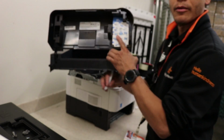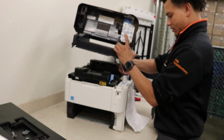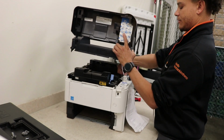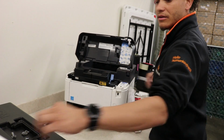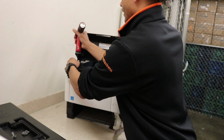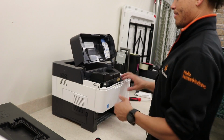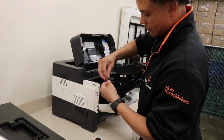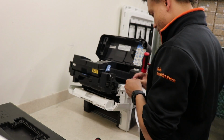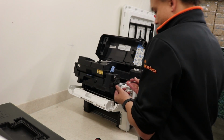Next up. All right, remember the ribbon cable, blue side towards you. Just press it right down in there evenly. Make sure it's all the way down, but don't press too hard. Back in, two screws. Make sure you're on a low torque setting for the plastic screws. I like to do two or three or four. And we'll put the drum clips back in. Use a flathead to get it in place and snap it back.